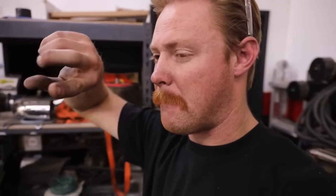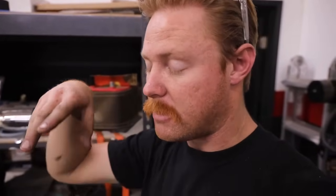So I'm gonna replicate that, have them roll to center and then weld the two tips together straight out at you. And I might radius cut the ends of them so they look really cool. I haven't really figured that part out yet. This exhaust might be temporary, so I don't really know what we're doing, but I'll find out some sort of tip and I'll start welding it on the car. Then I'm gonna stitch this whole thing up, try to get the thing to fire up. So we'll see.